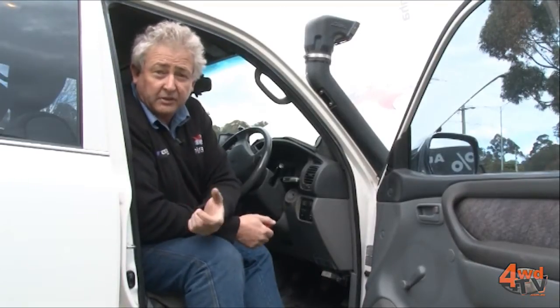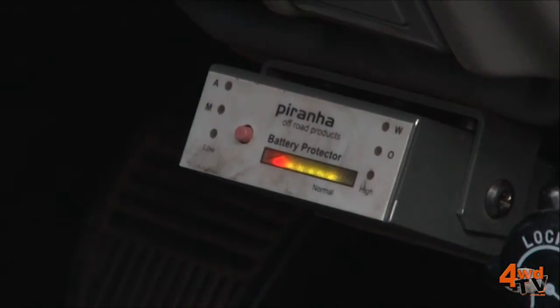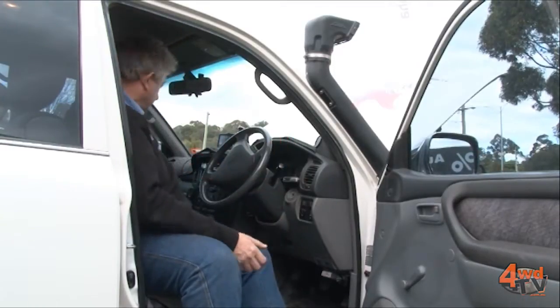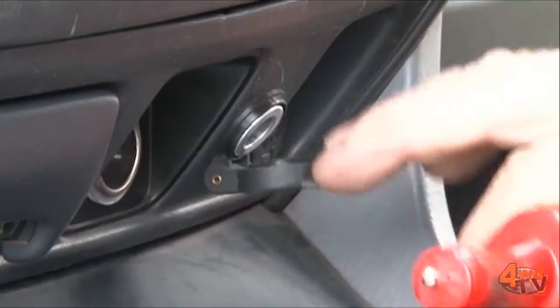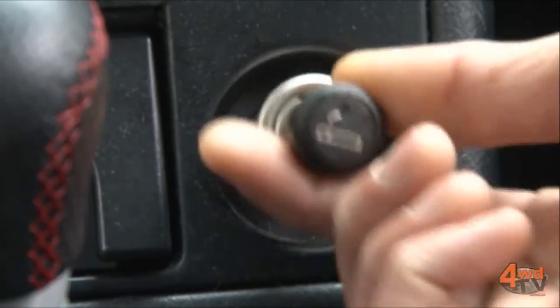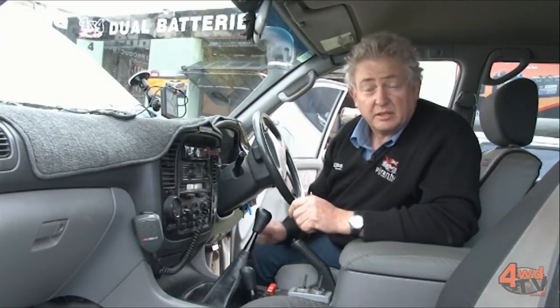What you see here is a bar graph display that tells us the voltage in the main battery, and by the push of a button, the voltage in the auxiliary battery. This car came as factory standard with cigarette lighter sockets — one that comes on and off with ignition, another wired to the auxiliary battery so it's live all the time, and a merit socket which is a high-amperage outlet suitable for running things like fridges. These plugs were supplied by Toyota but were wired with very thin wire to the original battery. We've changed that so these two are on the auxiliary system, so we're not flattening the starting battery — a very important part to remember.